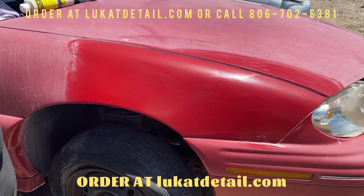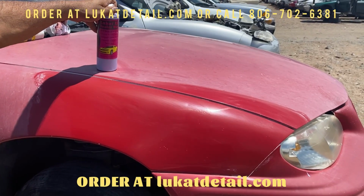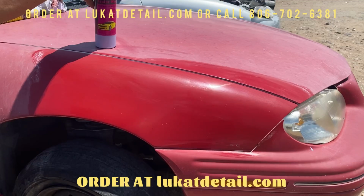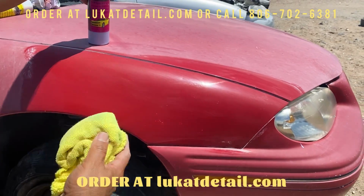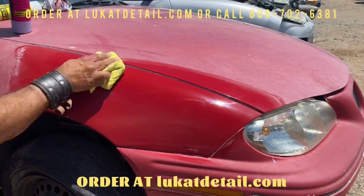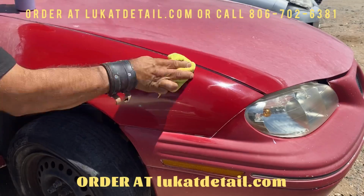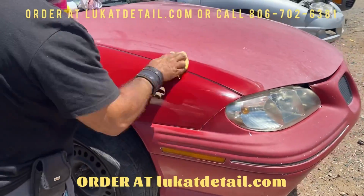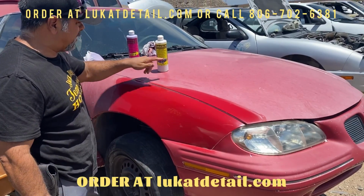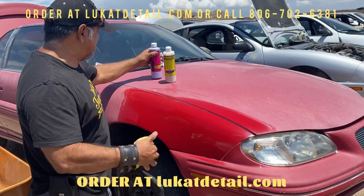Now, when you use the sealer wax, the longer you leave it on, the better. If you leave it on there for about 15 minutes, it actually leaves a really nice, tough, glossy shell on your paint job. Now, for the sake of time, it's already dry because it's hot, but look how beautiful it comes out. Okay? Go and pull back so they can see the contrast. So, you use this one here to clean the paint, the Lukat Fix It cleaner, and then the Lukat sealer wax seals it and protects it.